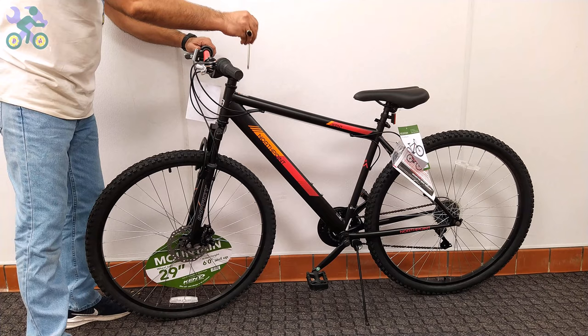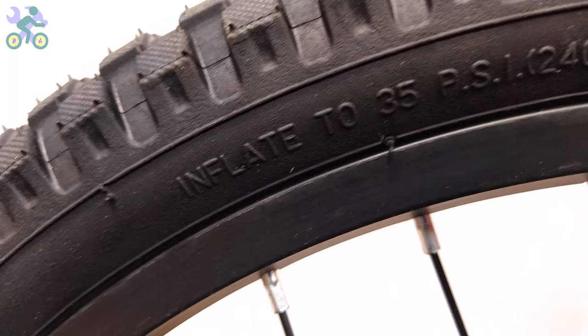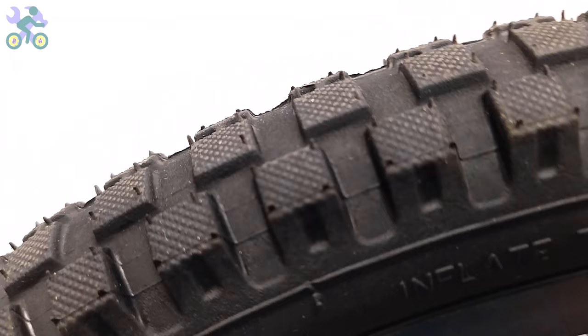At the end it's necessary to check the work done and make sure that all bolts and nuts are properly tightened. When inflating tires, note that the value displayed on the tire represents the maximum air pressure the tire can withstand. For most bikes the recommended air pressure is between 25 to 35 PSI. Alternatively, inflate to 20 PSI, sit on the bike to check, and if the tire is not fully inflated, increase the air. Remember the weight of the cyclist determines the amount of tire inflation.